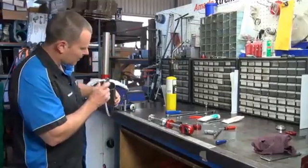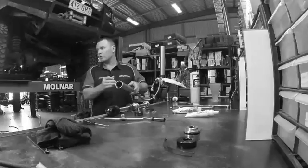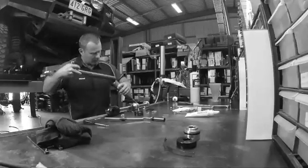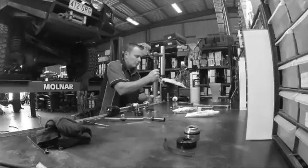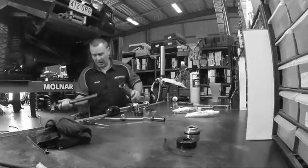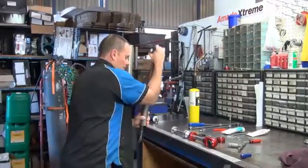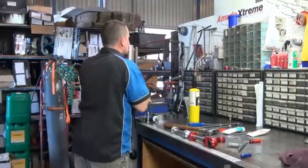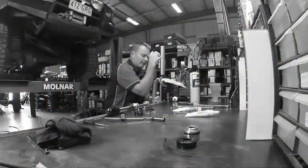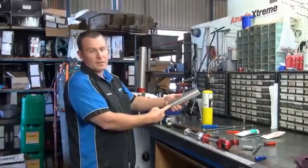For this situation, we've got that out now. You can see in there the floating piston — it's just a solid piece of aluminium that separates the oil from the gas. What we want to do is make sure that's pushed all the way up. A hammer handle works well because it's timber and it's not going to scratch anything. Just make sure your oil level is right — you don't want it to overflow while you're doing this because as you push that down, if it's over full it's going to spew out. That piston has hit all the way back down to the fitting.